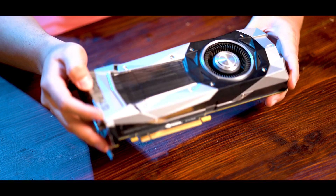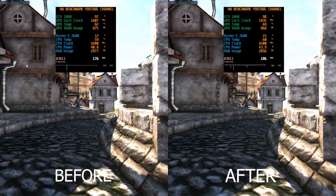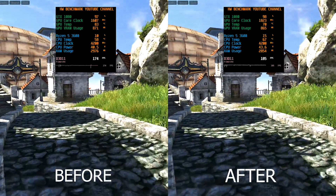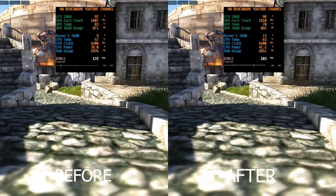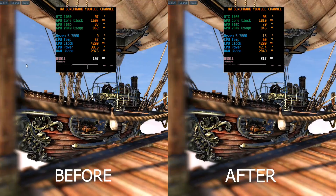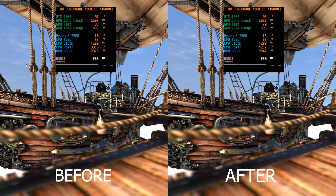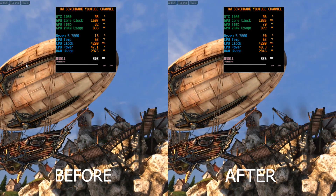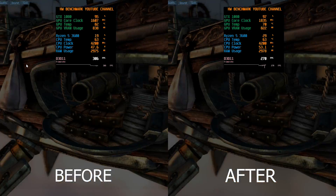So now that we've put it back together, it looks a lot better now and I'm sure the performance will be a lot better as well. Let's go ahead and test this now. Here are the benchmarks side by side. I put the fan at 100% so that way they're both controlled, and I made sure that my room temperature was the same the whole time. As you can see, the freshly cleaned GPU performed about 10 to 12 Celsius cooler, and it was also able to maintain a higher clock speed of 1810 MHz compared to 1607 MHz.